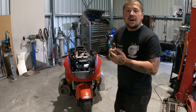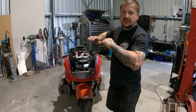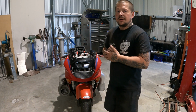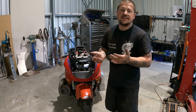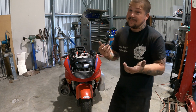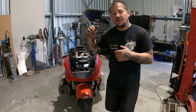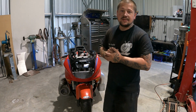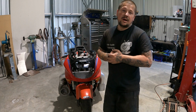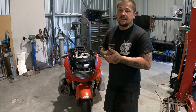These aren't turbo engines. So the only thing is, I do need to modify the sump, only because when it's on the rear air suspension, it's going to be sitting on it. So I need to address that now. So sump modifications would probably be next, and airbags. So take out the rear suspension now, and then we're going to get it dropped down to see where it's actually going to sit on the rear. Do the air suspension as well at the same time, and also the oil pan modifications there.